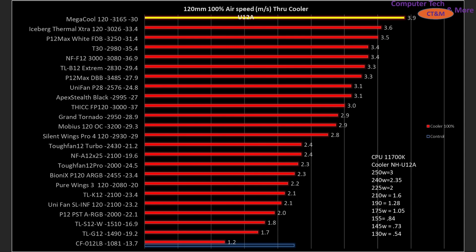How about at 100% PWM fan signaling? I've got a new number one fan. It is right at the top, and it's moving 3.9 meters per second of air through my cooler — that is crazy. Now, this is at its full rip-roaring close to 3,000 RPM, and you need to select it to operate at that RPM; otherwise it's limited to 2,000 RPM and you won't get nearly that level of performance. I'll have the raw data at the end so you can actually see where it lines up. But this fan hauls — though it's also quite noisy.